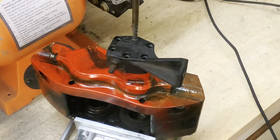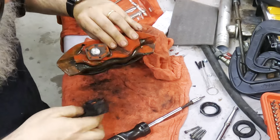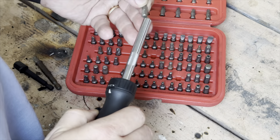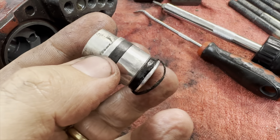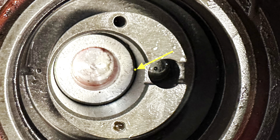The e-brake body is on the back of the caliper. It has six small allen screws, one of which I immediately stripped and had to remove with an extractor — which actually worked, surprisingly. The bolts are a non-standard size, so I had to order from McMaster-Carr again. Under the cover is the plunger, which comes out from the other side — hidden under a cap behind the piston closest to the inlet. That cap is held down with security screws, but my security bit set handled it. Behind that are a couple of return springs and the plunger itself. The plunger has two O-rings on it, and the one closest to the piston was damaged. I didn't think it was causing my seizing until I tried to clean the inlet passage — which is incredibly small and sits directly in front of the e-brake plunger. This tiny hole is how all of the brake fluid gets in and out of the caliper.